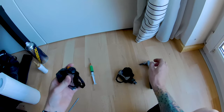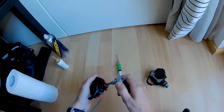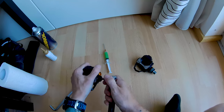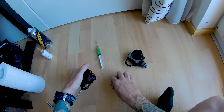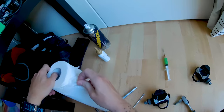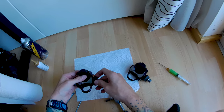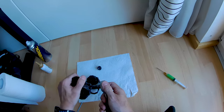Let's start to open things up. Here we have a Torx — this is a Torx 40. On each pedal the direction to open the cap is different. On this one it opens clockwise. Let's clean out the old oil and dirt just in case.